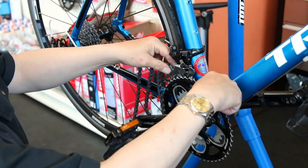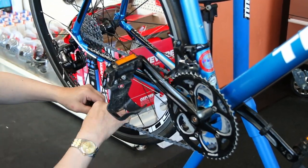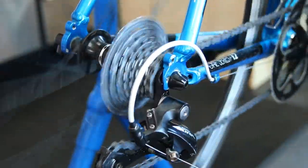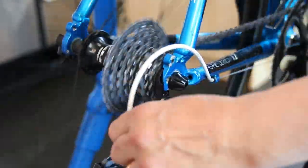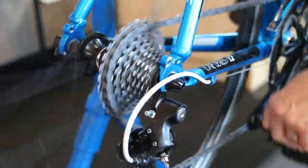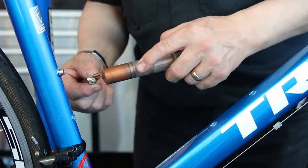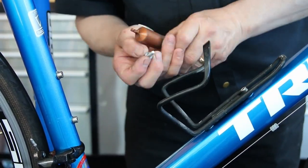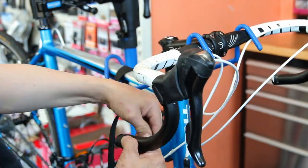We did put a new cable on the rear derailleur, but all the other cables on the bike appeared to be fine so we didn't replace those. It was fairly routine in the servicing part of this bike — just a case of ironing out the issues with that rear derailleur. You can see it's now shifting gear perfectly with the fresh wax chain with none of that grease and debris on the bike. I also added a new bolt to the frame to replace the missing one, just to make the bike look a little bit nicer.